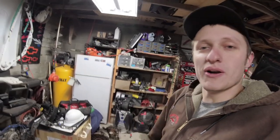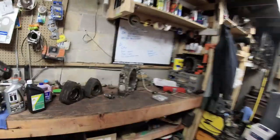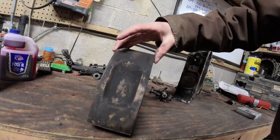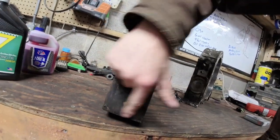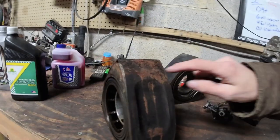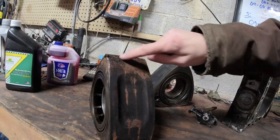If you're doing that, you need to make sure that you are burning all of that oil that you're injecting into the combustion chamber. When you don't burn all that oil, the inside of your engine will start to look like this. You can see this RX-8 rotor that I have out of the engine has a ton of excessive carbon buildup, some rust. This came out of one with a blown coolant seal. But all of this little sandy dust is all carbon.